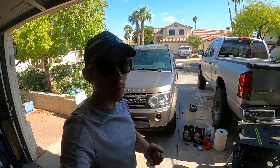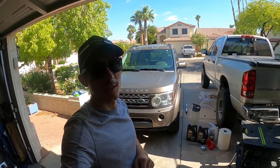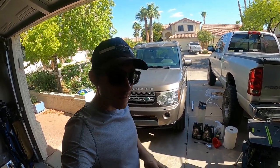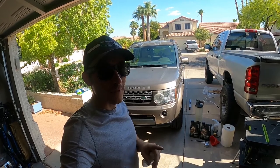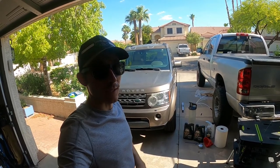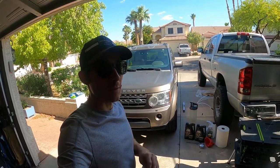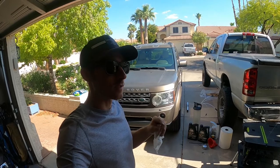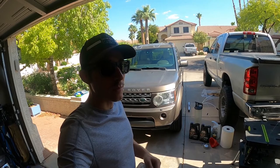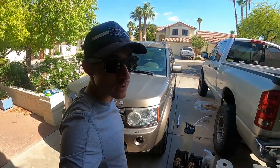This oil change is probably different than most other oil changes you've done before, but you're going to like it - this is my favorite car to change the oil in because you don't have to go underneath the car. Everything is accessible right up top. However, it is a little quirky in that this car does not have a dipstick. The way you check the oil is electronically through the computer, and the annoying thing is you have to wait till the engine cools down before it will give you a reading. You definitely want to make sure you don't overfill it.